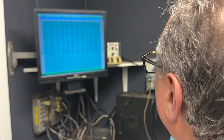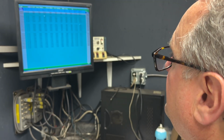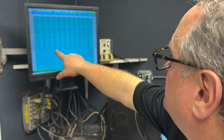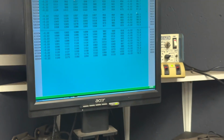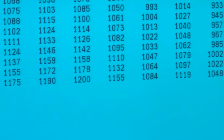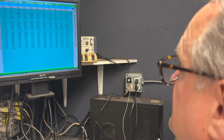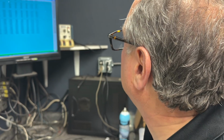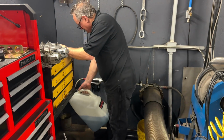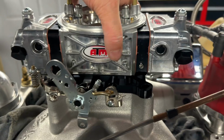This sounds really good. The EGTs were all right, in the top here was mid 1100s. At the top it was 1150 as an average. It's pretty good. I don't know how we can do any better. So far with the new heads and intake, we've already made 9 more horsepower on gas than it made last time on E85.